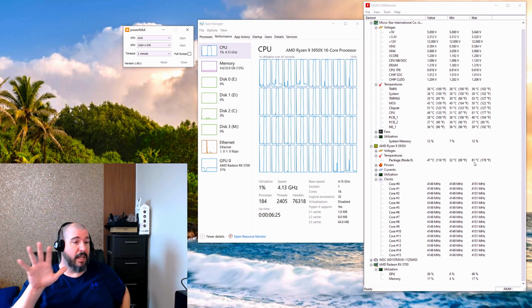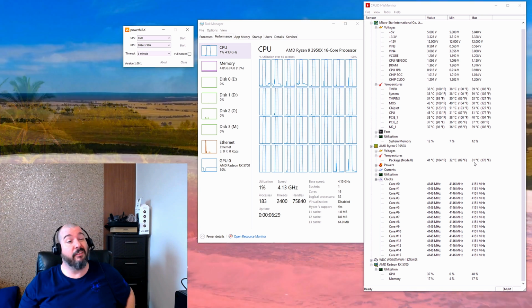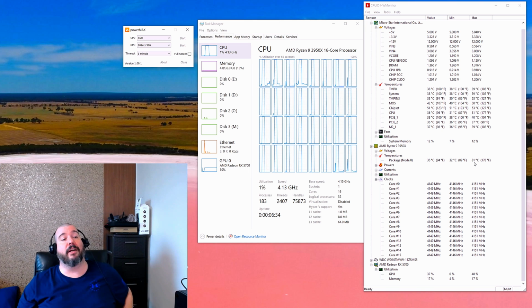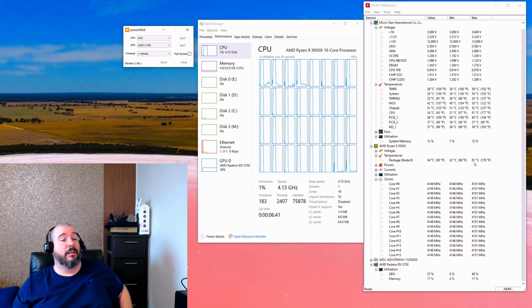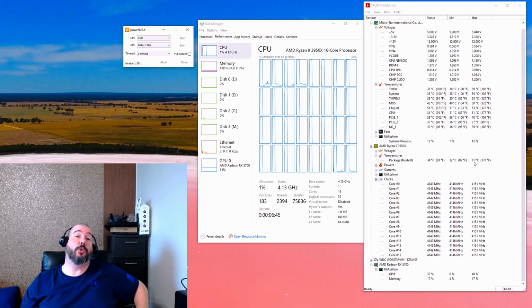My speed, I lost a little bit. I went from 4.25 to 4.15. Even at 4.175, I was still a bit flaky, but 4.15 seems to be stable. That is probably due to a limitation in my all-aluminum liquid loop there. How often do you get to say that you've run into a metallurgical limit?